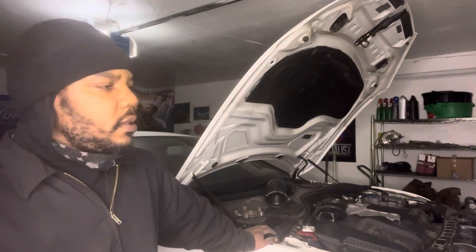I'm not going to get into too much detail — both my GoPros are down — so I'm going to go over what I've done so far since I got the car in the garage. Safety first: chalk the wheels, get your car secured on jack stands, and once you have the jack stands in place you can pull the wheels off. I have the wheels off right now and I pulled both fender liners out so you can access everything.